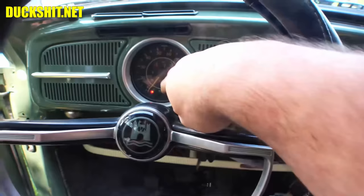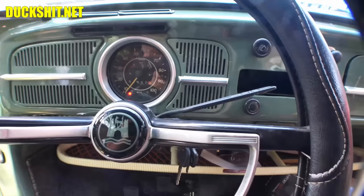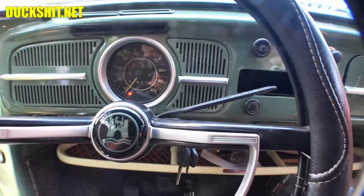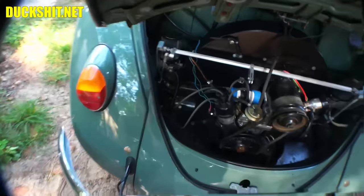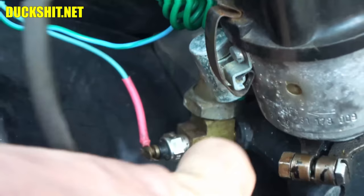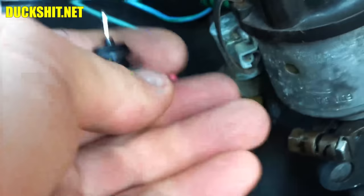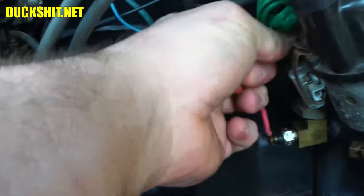Let's take care of that oil pressure light next. That really bothers me because I shouldn't even be running the engine unless I really know it's making oil pressure. That's been a big no-no all along. I assume it's been fine because it's been driven this way for a long time, so it's probably okay, but let's attack that next. We've got an oil pressure switch right here. These are super easy to change, at least on a stock Beetle engine. This one has a little bit of a modification due to an oil pressure sensor that somebody put on here. The oil pressure switch is right here, standing vertically — normally it would go in horizontally into the engine block. We're just going to unscrew this thing, drop the new one in its place, and reconnect the one wire that attaches on top.